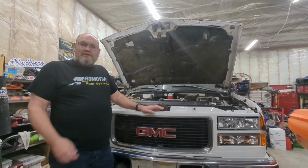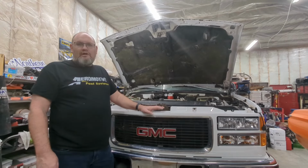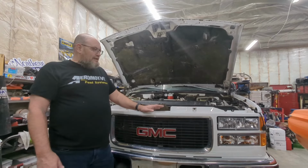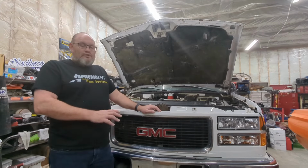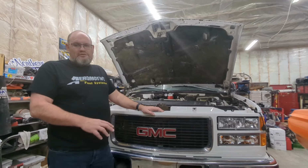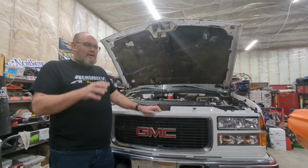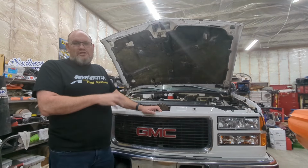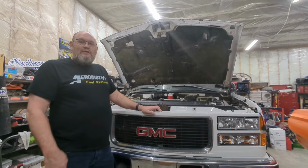Today I'm doing a quick video to talk about doing the aftermarket turbo upgrade on a 6.5 GMC turbo diesel. So this is my first time doing it, but what I've decided to go with on this truck is to take the stock GM turbo off, and I'm going with an HX35 turbo made by AVP.